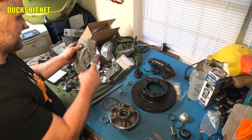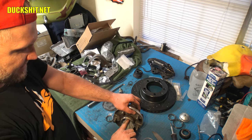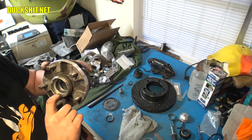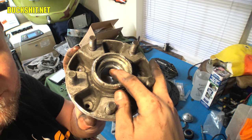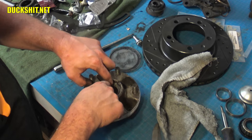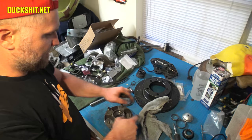It appears where I used the punch I accidentally gouged it — you see that little tit right there? I can fix that real easily. I'll get in there with a file and a piece of emery and just clean it up. All cleaned up and ready to go. Grease up the bore. The spacer fits in there without having to hammer it in — they actually just dropped in. I learned that from the first one. It's a near exact fit in the outer race.